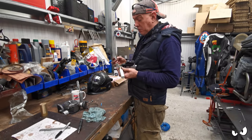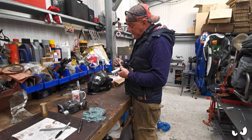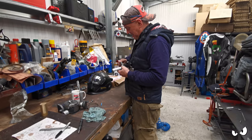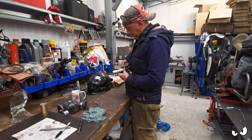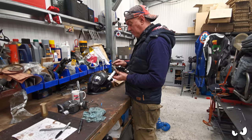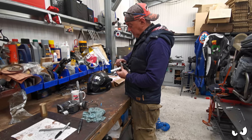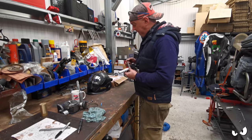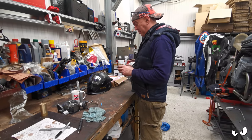Basically, I've dressed up the welded stuff. It still needs prettying up, but I'm just gonna leave that for Steve-o to give him something to do when he's down here next. So if we stick this on here, basically by moving this little brackety jobby that I've done up and down the threads, you'll be able to change the position of the foot pedal. So I know I'm basically setting it where it was before. He didn't seem to complain about it. And if he wants to change it, he can change it, can he?